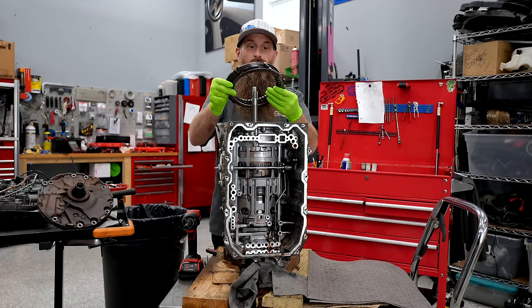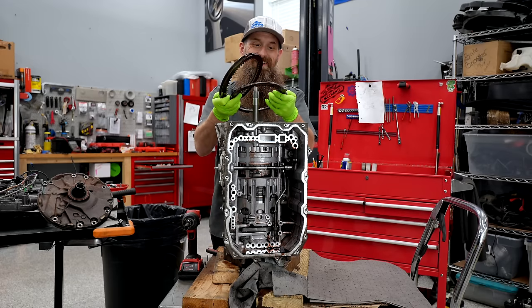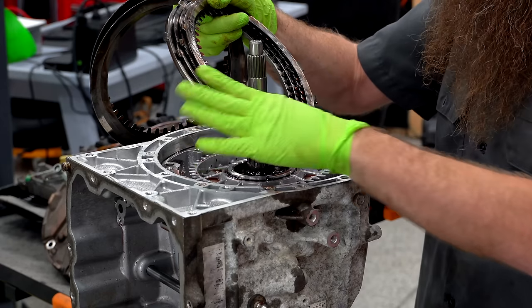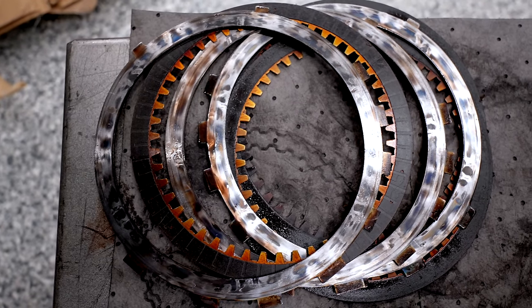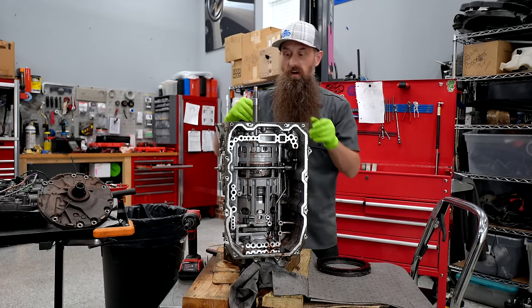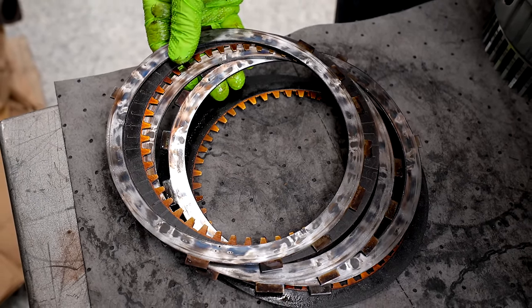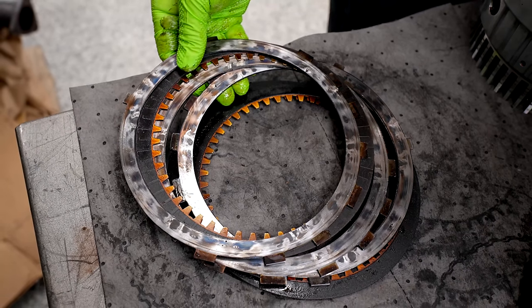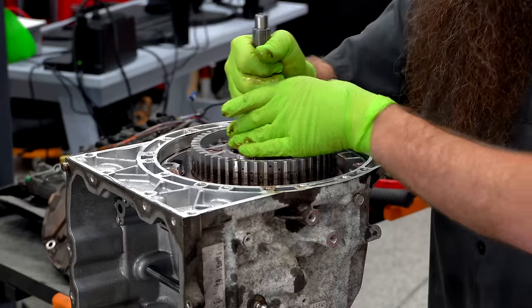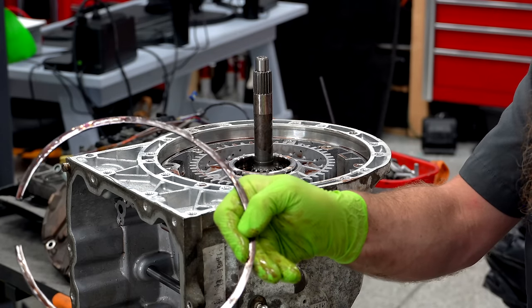So we have steel discs as well as our friction discs. I don't want to give it away already, but one of these steel bands is absolutely smoked — look at all these dark spots. That is from slipping and overheating, so that is likely one of the causes of our problems right there. Even though the steel discs and clutch packs here are absolutely smoked, don't go — we might actually have more problems. A little later in the video we're going to talk about exactly how all this stuff works. It is important to note that we didn't really have any fault codes stored, which is not uncommon. Even this guy looks like it got hot-spotted.